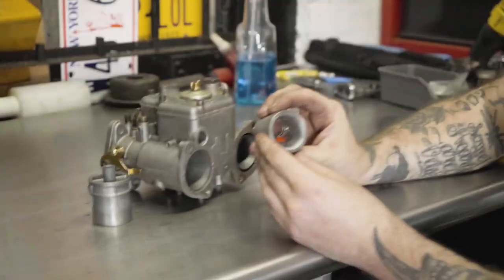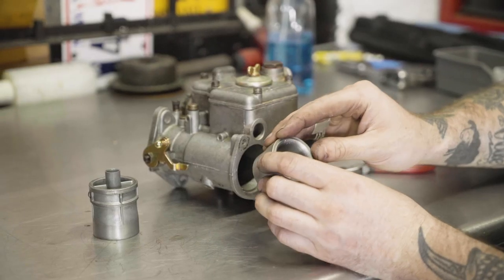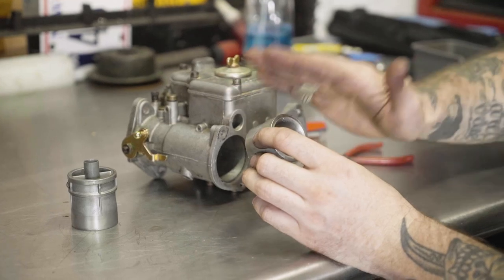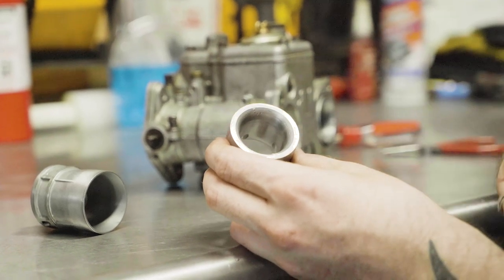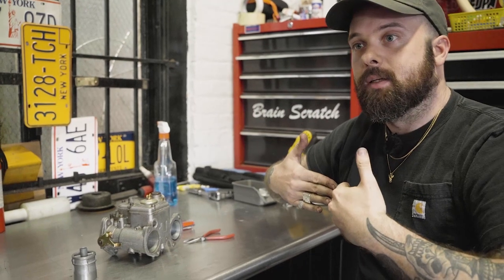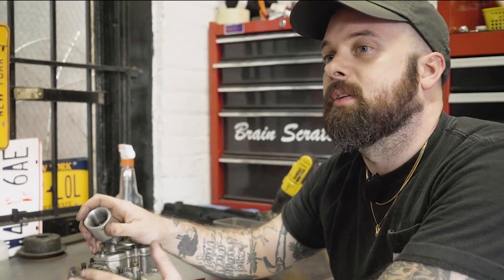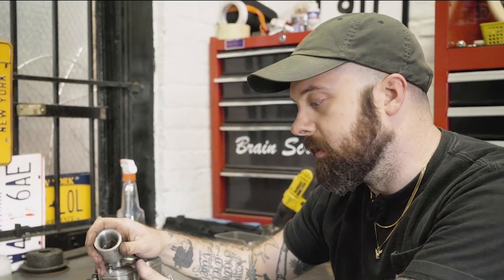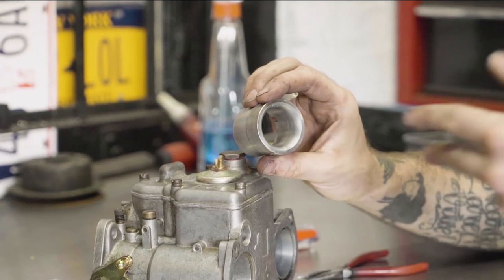These are your chokes. Right here we have a 30 mil choke. This controls how much air enters the combustion chamber through the carburetor. What you're doing essentially is choking down the air velocity inside the carburetor. If you have a larger choke, the engine's going to have a harder time sucking in enough air at idle. Think of it as a funnel — the air coming in from the vacuum is dragging in at a higher velocity, so it's easier to calibrate how you richen up your air mixture at idle. As your car sits at idle, it generates a constant vacuum behind the throttle plates. When your carburetor is choked down to a smaller size, the air comes in at a quicker velocity because it sucks through a tighter hole.